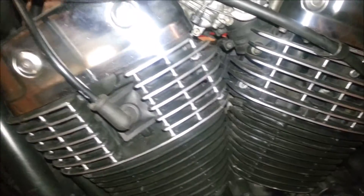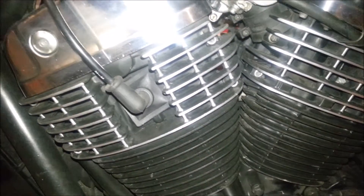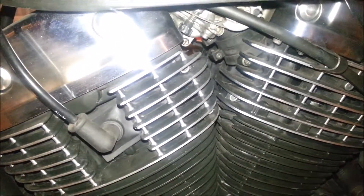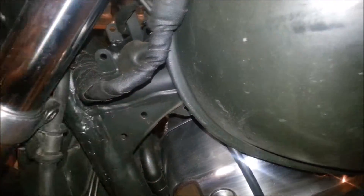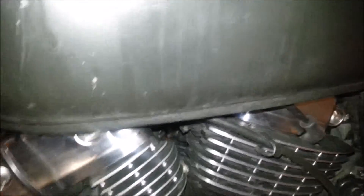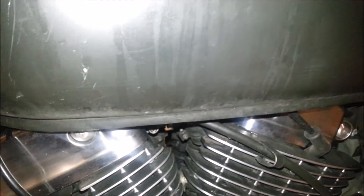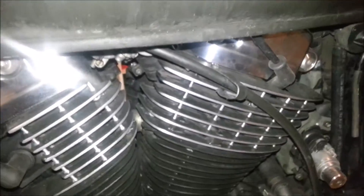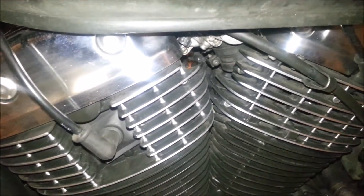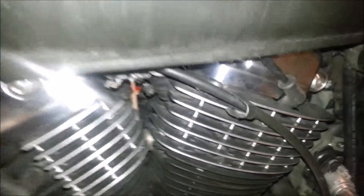That job is going to be a real big pain in the ass for two reasons. I'm going to have to take the tank off to get to the front of my frame, so I can stick a really long screwdriver down in there to reach the sync screw on the front of my carburetor — that's going to be a bit difficult. I'm going to need an external fuel source while the tank is off — suspend it above the motor, use a bottle or gas can if I can rig it up so it doesn't leak. After I get that done, this bike should run really well, but I won't be able to test it because all the roads are covered in snow.